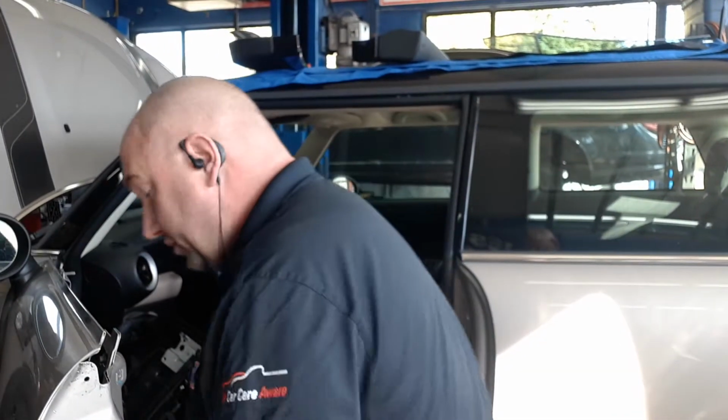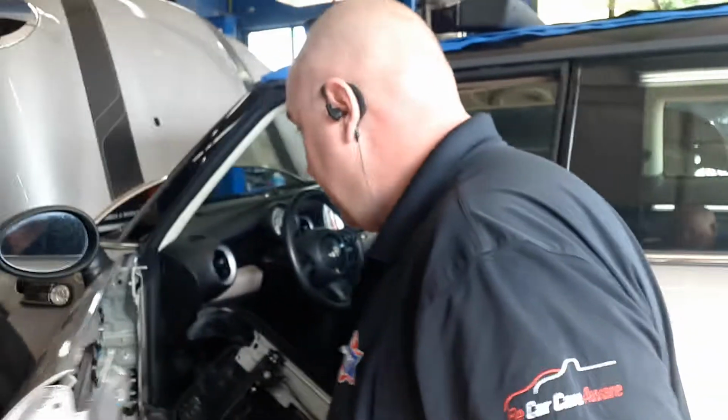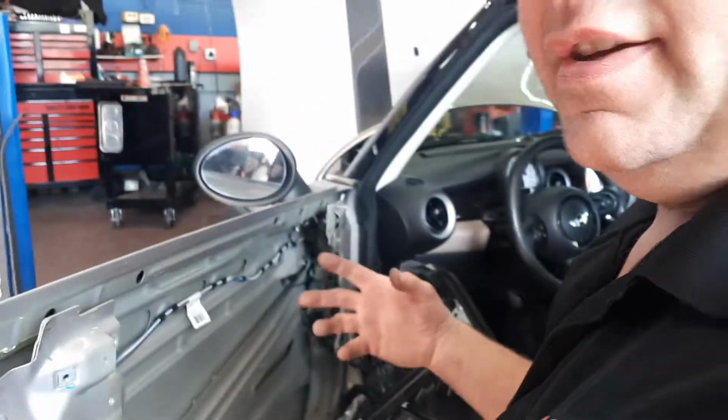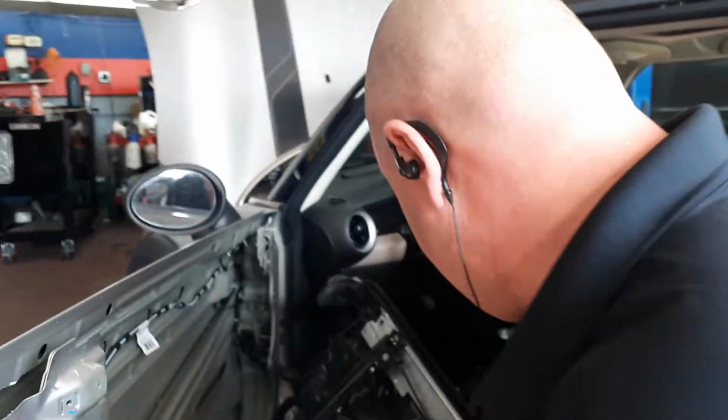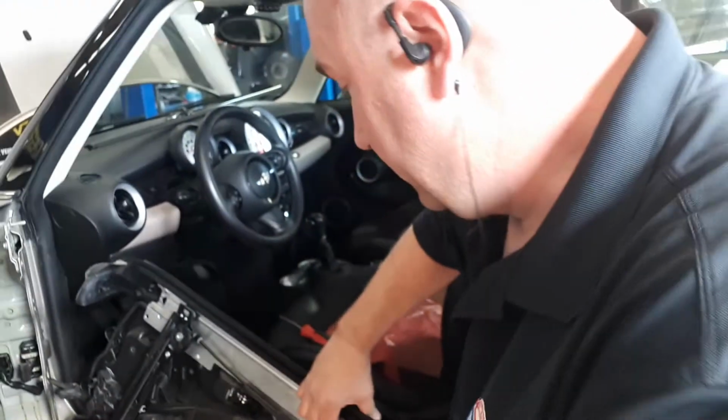And the issue this customer is having, when they try to lock their car at night, it'll stick and the solenoid will stay partially energized, not fully released, and is causing a draw in the system, killing the battery overnight. And so we're replacing that to fix the draw, but obviously to change this, the whole door frame comes off the vehicle. And this is the whole regulator assembly.